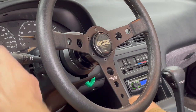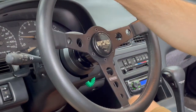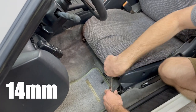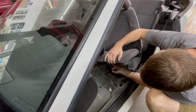Simply connect the positive and ground wires and pop the horn button in place. The final step is a quick check to make sure the turn signal canceler and horn work properly. Everything checked out, so now we'll move to the seats. Start by removing the 4 seat rail bolts. Disconnect the seat belt connector and the seat is ready to come out.